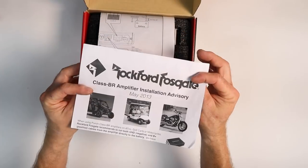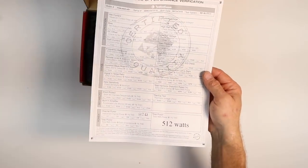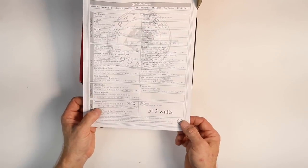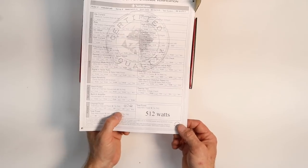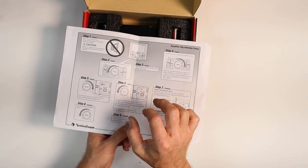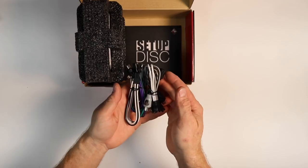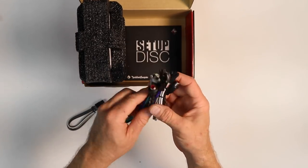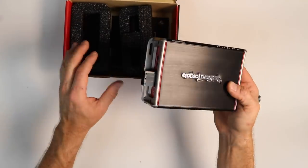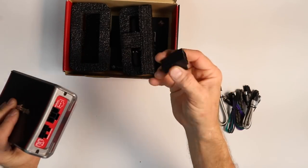Now unboxing the new 400 — it starts with the same motorcycle grounding instructions and burn-in certificate. They've changed the burn-in process: this version gives you the total output of 512 watts — 127 watts a channel on the front two channels and 129 watts on the rear two. There's also a new sheet with instructions for the Clean circuit that's built into it, and how to wire the amplifier up. The box comes with the same connectors as the 300: two with RCAs, two with wire. Located in the bottom is your Clean setup disc — keep that, don't lose it.